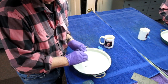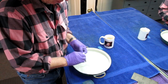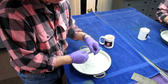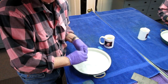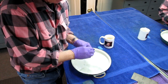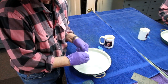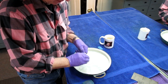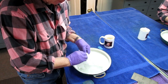Once you polish the harder alloys, they stay polished a lot better. Conversely, when you buy aluminum at Lowe's — low-end aluminum — it's really almost butter. I made about 150 camera mounts for all the bikes out of that stuff — very easy to cut with a hacksaw or Dremel tool, very easy to sand, very easy to polish. In this case I'm not sure if it's 2024 or whatever because I don't remember what part I made out of it. When I was involved in the machine shop, I used to come home with scraps of 2024 all the time. We used to make landing gears for the model planes out of 7075, and because those are aircraft alloys, they really polish up nice but are a lot of work to polish up too.